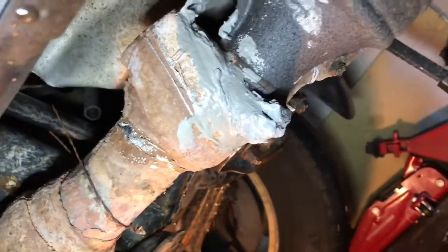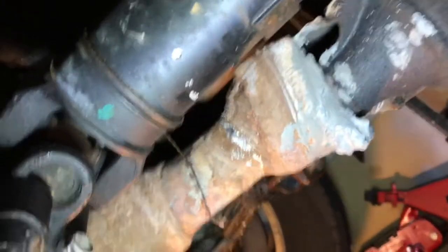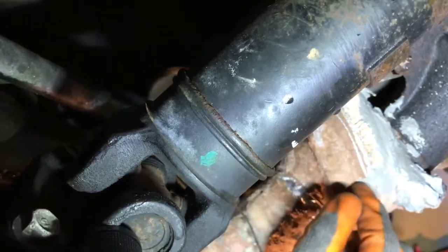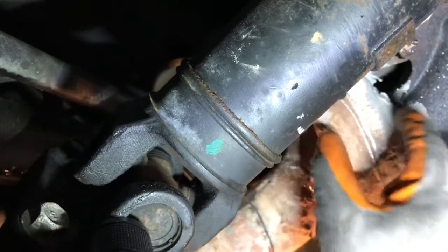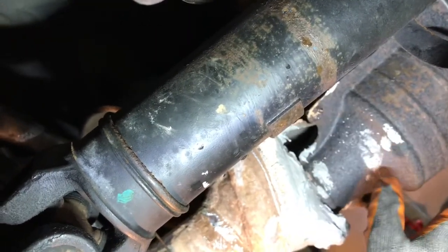I'm going to put a lot of cement to fix this. But it's kind of crazy — I can't really put that much cement in here. If the split is small you can do that, but if it's like this, it has a big split. Some of this cement stuff can go inside and clog the catalytic converter. So try not to do that.